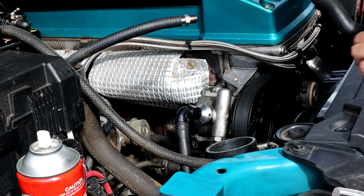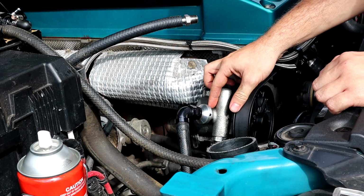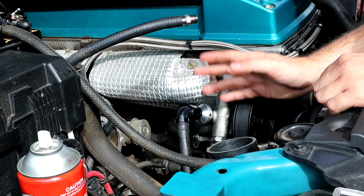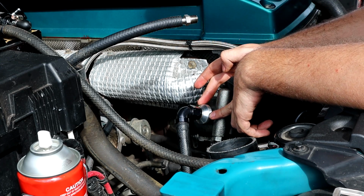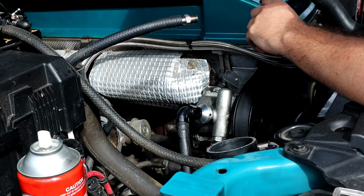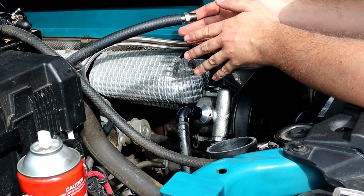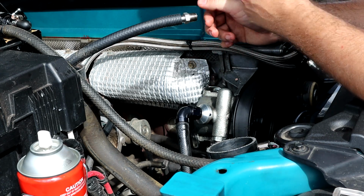Alrighty, so the next point I'm going to be draining some fluid out of is this fitting right here. So it goes to a little fitting that Mackie made, basically, that goes up to the standard power steering pump from an FG Mark 1 and backwards to a BA when they first came out in 2002, exactly the same pump. So now what I'm going to do, I'm going to undo these 3 fittings around here with an Allen key, and then with the reservoir raised, I should be able to hopefully get more fluid out of this return line here, and then I can pretty much get the relocation out, and then we can hopefully start fitting up the new pump ready to go in.